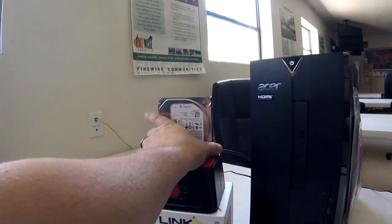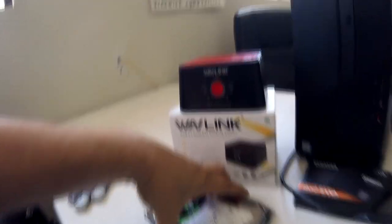Now that it's off, disconnect the drive and we'll install the one terabyte SSD. If you're not familiar with SSDs, the Samsung is really one of the best out there — it's just fast. You're talking a complete difference from a mechanical hard drive to an SSD. Your normal startup from power button to being ready on your operating system usually takes a minute to two minutes on a mechanical drive, but on one of these we're talking seconds.